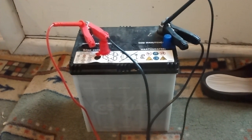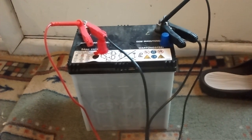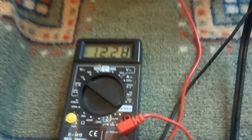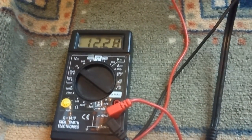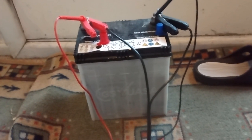Probably because we left the car unused for a few weeks, which we shouldn't have done. But nevertheless it never actually regained full voltage after overnight charging from Honda, and we can see it's only reading currently 12.28 volts — but it should read 12.6 volts, as a car battery normally has six 2.1 volt cells.